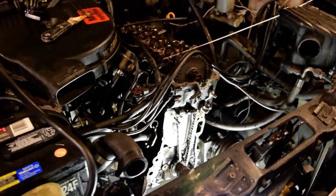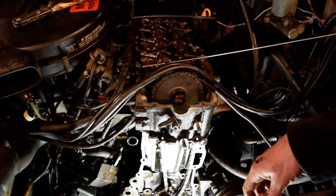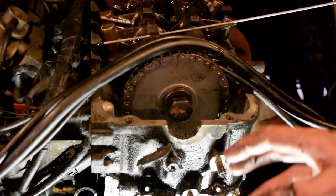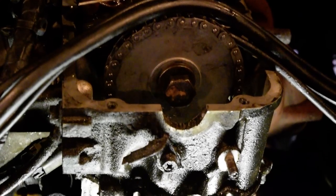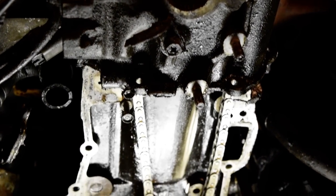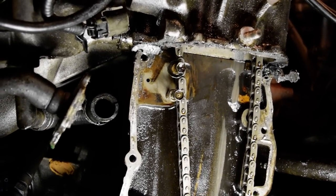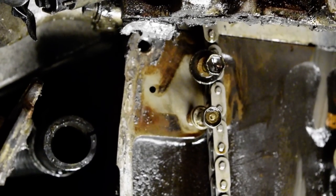So what we're trying to do — I just replaced this timing chain and sprockets and all about 12,000 miles ago, and it's already started to slap again. So I figured we'd bring it in the shop and go ahead and try to come up with our own homemade fix to get this thing to stop slapping when you first crank the truck up, because that's what tears them up. What we're working on is a spacer on the chain tensioner to keep that from happening when you first crank the truck, and that will keep the guides from getting torn up.